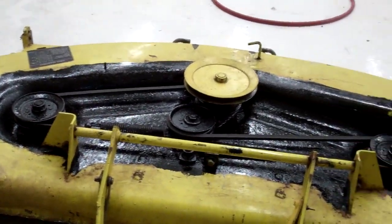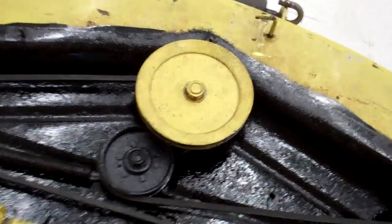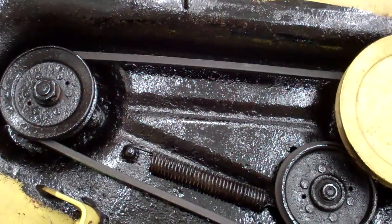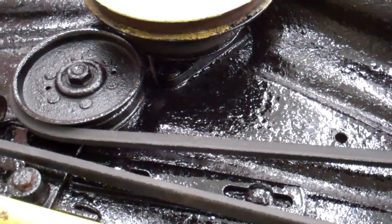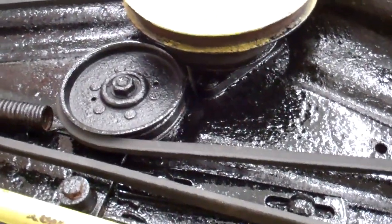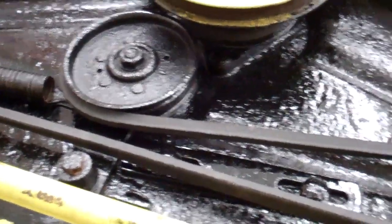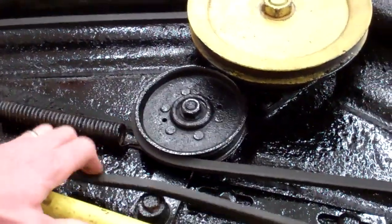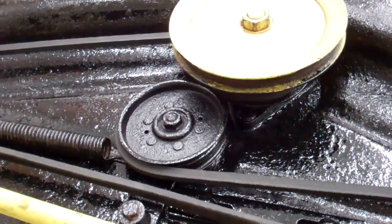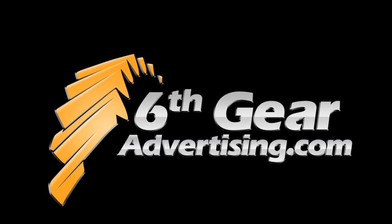Now that it's nice and clean, I'm going to show you what the problem was. Over the years the inside just filled up with grass, and there are some drain holes throughout — one down there, one down there, one by each bearing. Those get clogged up, more water stays inside, and it just continues to get worse. Remember how rusty this was where the tensioner wouldn't even move? Well, it's a nice before and after — that's how it should work. We're good to go.